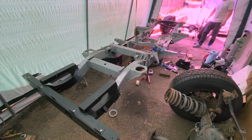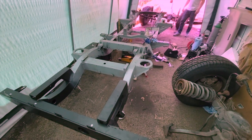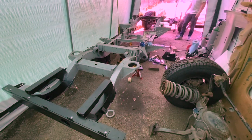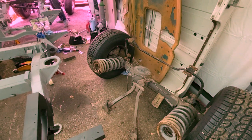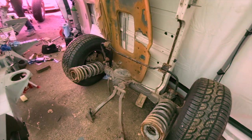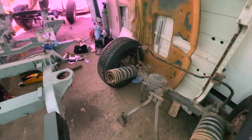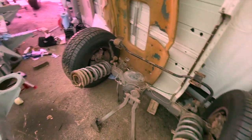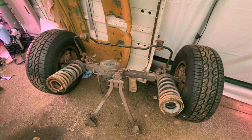We've got the axles off, so at some point we need to flip it over. Lewis can then weld up the bottom of the replacement piece. We can get any brackets off that we don't want on there for the sandblasting process. And then we'll have to completely dismantle the axles as well to get all the additional things like sway bars, all of the steering assembly at the front, radius arms on the front, springs, etc. Need to get them off so that the chap who comes and does the sandblasting's got a real good run at the axles.